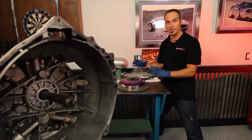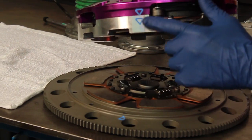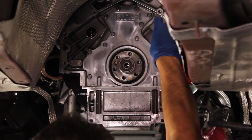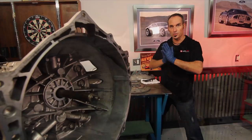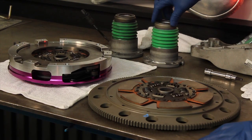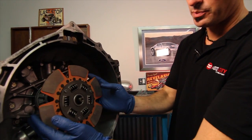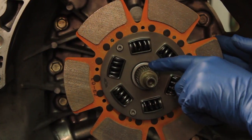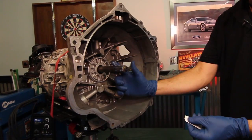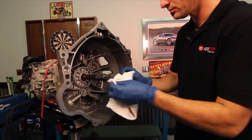With clean gloves, this is where we get to start playing with the new goodies. This is our twin disc clutch from Exedy. We've got it disassembled so you can see the arrows — you want to realign those when you put it back together. With clean gloves, we've got everything cleaned up on the engine side with a little brake cleaner, wiped everything down, and inspected for any nicks, gouges, or burrs that could create issues when we put it back together. Did the same on the transmission side. We've got the old throwout bearing out and the new one ready to go in. We're going to check the splines carefully — make sure everything floats nice and smooth with no burrs that could cause issues with the bearing moving back and forth. Once that's good, get the throwout bearing in there and lube it up a little bit — a little bit goes a long way. Get it in there, then wipe it clean, because that stuff will fling all over your clutch and ruin a brand new setup.